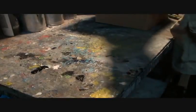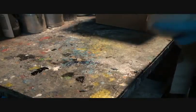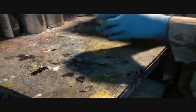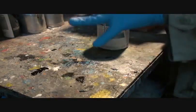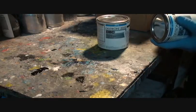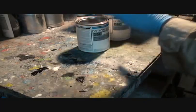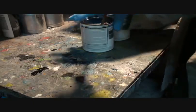The color we're using on our yellow is called Lamborghini Yellow. We also use PPG Deltron 2000 — that's all I use as far as paint goes. I do use variances and clears, but as far as the base coat paint itself goes, that's all I use. This is a tri-stage paint, so it takes two different colors to make this yellow. I'm going to go ahead and show you what it is.